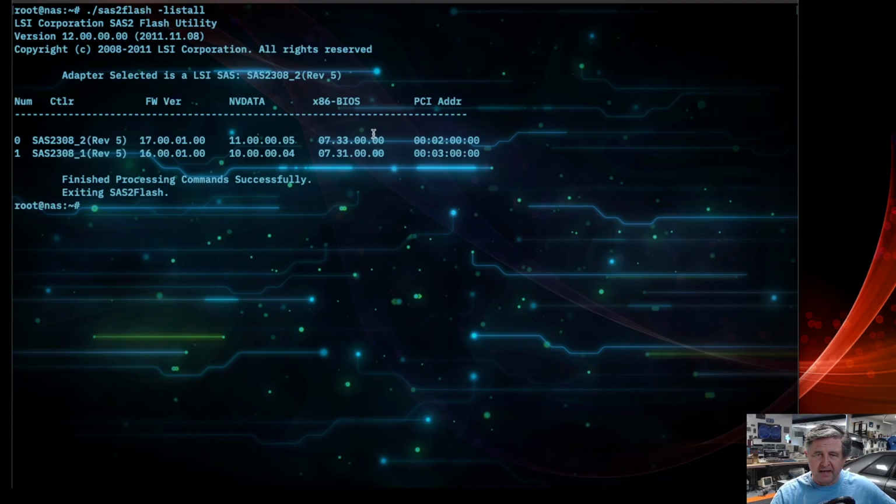So it's probably worthwhile for me to upgrade those at some point. Sometimes the firmware upgrades fix compatibility with some drives. I think that on some of these, the BIOS upgrade will also change support for more disks. I remember one of them, if you had more than like 128 drives, you had a problem. So not something we're going to have today, but something to be aware of.